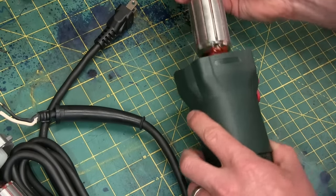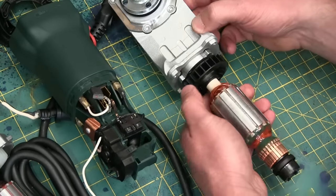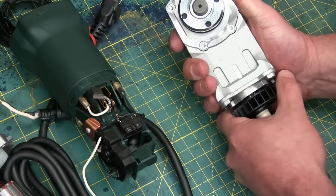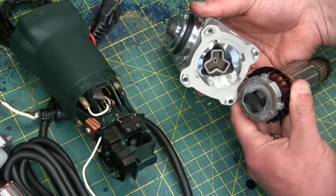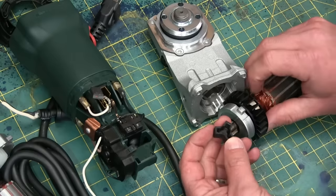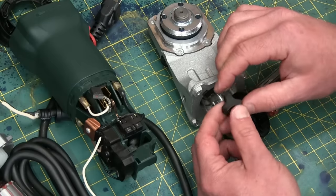I ended up pulling the whole rotor out — the fan assembly, just for airflow. And I wonder if this is belt drive or if there's a shaft in here. There has to be some sort of power transmission. Big long pinion maybe. Whoa — that's a new one. Lovejoy coupling. Strange. It's even got a spider — a real soft elastomer. That's something you don't normally see in a grinder.